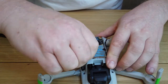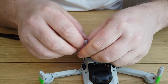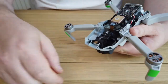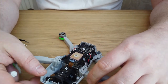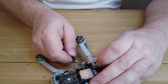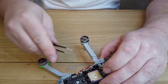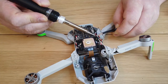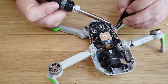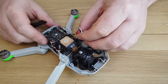Next, you want to take off the pin that goes through the joint on the arm. Remove the two screws, and then on the other side you'll see that pin — just push it through and it should come out easy. Whatever position you start in, you need to put the drone's arm back in the same position. The glue on this bit is quite tricky to get off — just go easy on it. Then remove the grey wire out of the channeling. When you're desoldering, don't put too much pressure on because it gets hot very quickly — the last thing you want is to burn the circuit board. Just keep feathering it on until it melts and you can pull off the wires quite easily.